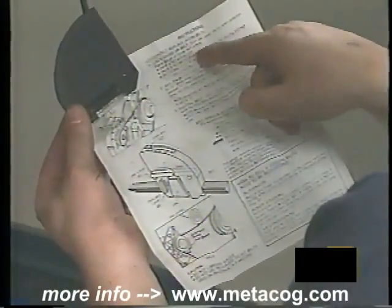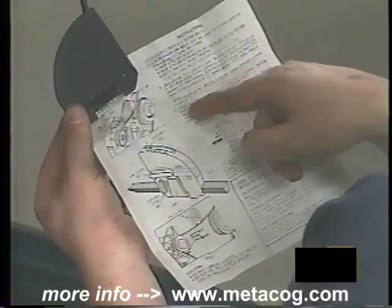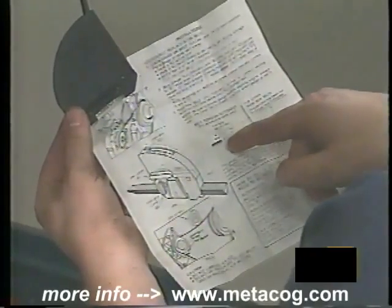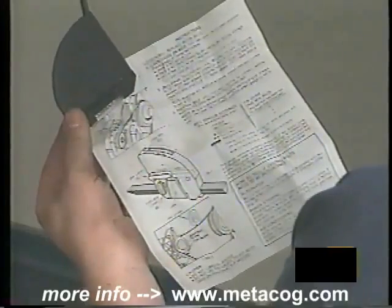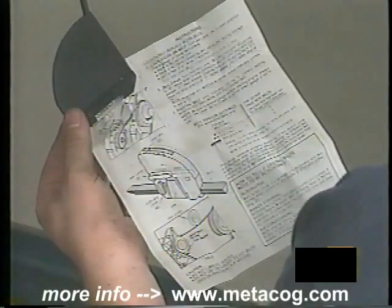Using a belt tension gauge, check to ensure the belt is tightened to the proper specifications. A belt tension gauge, as shown, is inexpensive and will ensure correct belt tension for increased belt life. If the belt is not the proper tension, the self-tensioner may need to be adjusted or replaced. Refer to a service manual for further details.